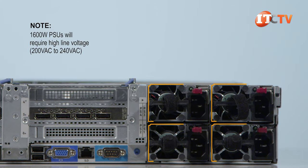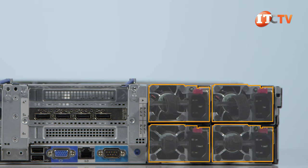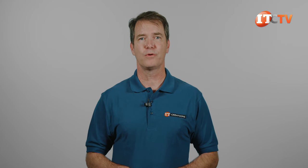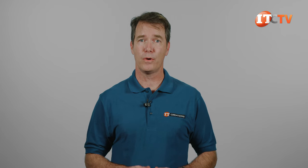Powering the system are either two or four 800-watt or 1600-watt power supplies. With four power supplies installed, the tertiary riser option is not supported because there is simply not enough room. The HPE DL560 Gen10 server is one of the world's most secure platforms, along with the rest of the Gen10 product line. Security features include digitally signed firmware that won't even run unless verified via the integrated iLO 5.0 management subsystem and HPE's secure encryption.